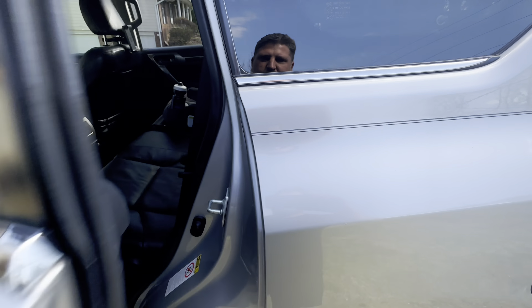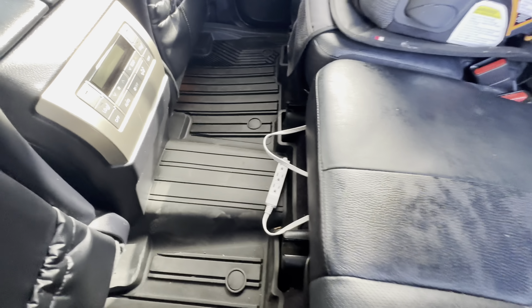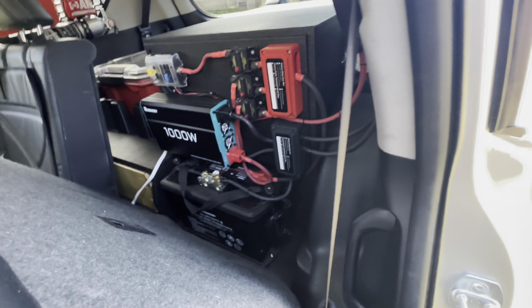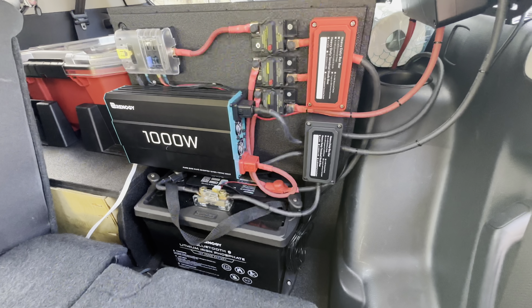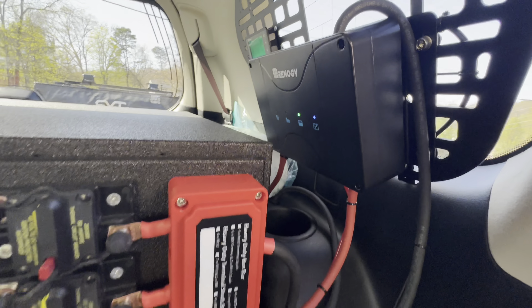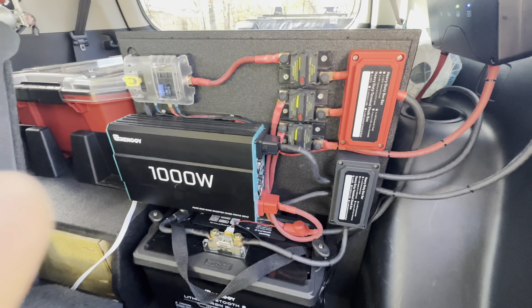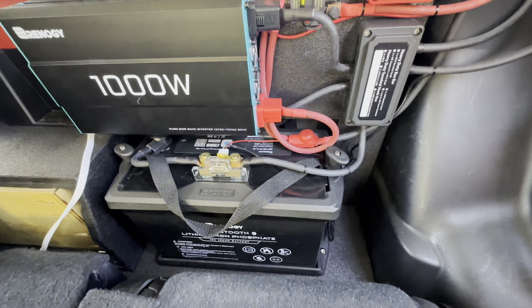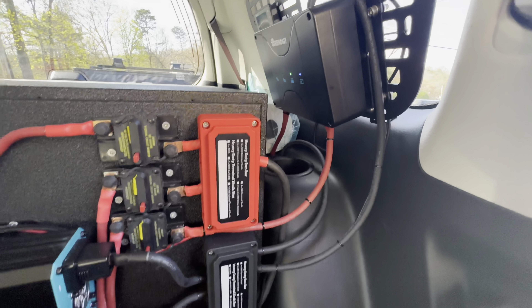Let's hop in the back seat and I'll show you the power rig. It's kind of janky but it works — I have a power plug running from my inverter just hanging out in the back seat. Back here is the house power rig. It's relatively simple: really just a charge controller mounted on a Bison Gear panel, a couple bus bars, a fuse box, and an inverter. All running off a 100 amp-hour lithium-ion battery. The charge controller can accept solar but it's not hooked up right now — just running off the alternator.